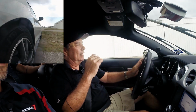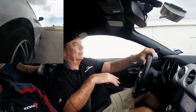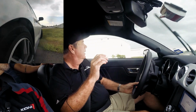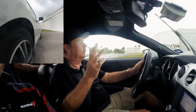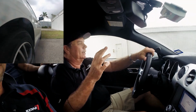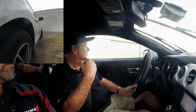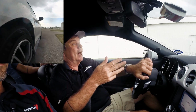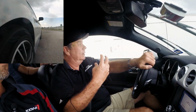We'll go ahead and do that demonstration again. In the video prior to this, it didn't pitch up and down nearly as much as that. And that goes to show you how much control the new KONI Active system has. We'll do it again. Here we go, look. It starts to frequency out there on you towards the end, where the Active system had much better control. And that's just changing up the variable valving in the damper to handle the different inputs that are given to the damper itself to give it more control.